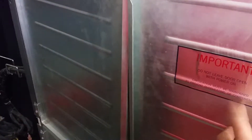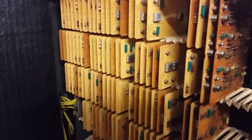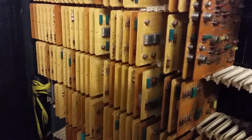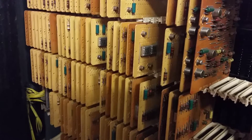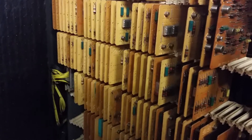Wait a minute — there's only one gate, which is very interesting. There's a whole lot of air in this one. I opened up the doors to the gate and this is just looking very weird. To my surprise, look at this — it's a different technology. There are still SMS cards, those phenolic papery cards, but they've got the 360-era aluminum cans on them, which were sort of hybrid. They're not quite ICs — they actually do have individual little transistors and diodes and things like that, but they were the next step in IBM circuitry.